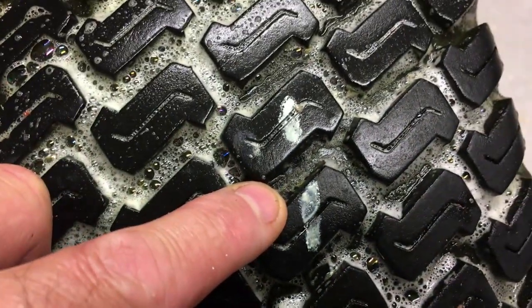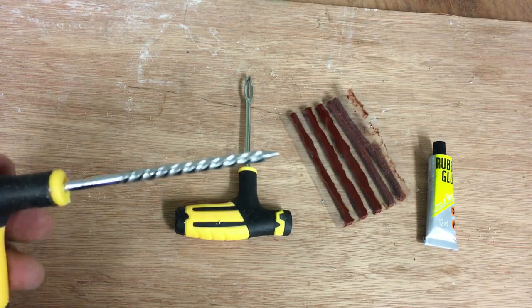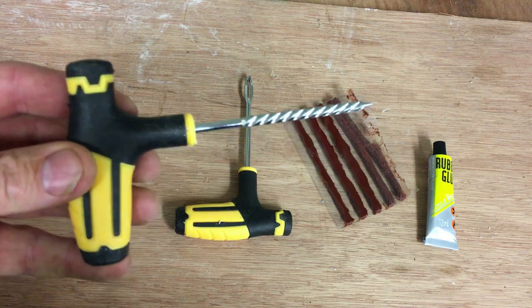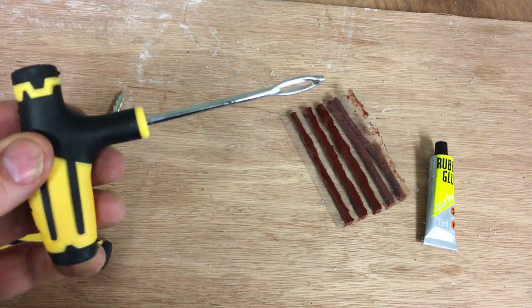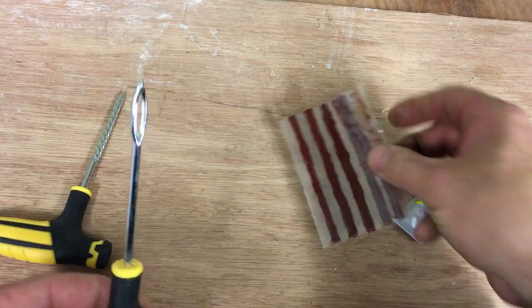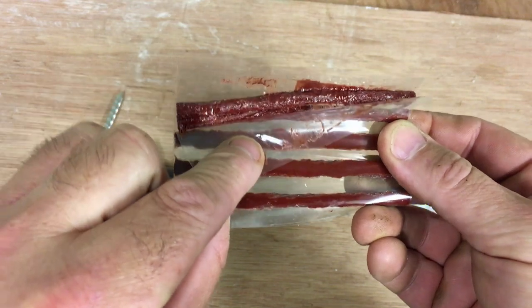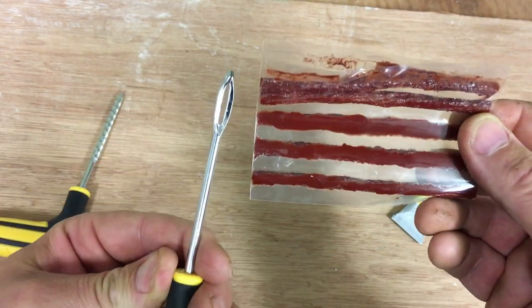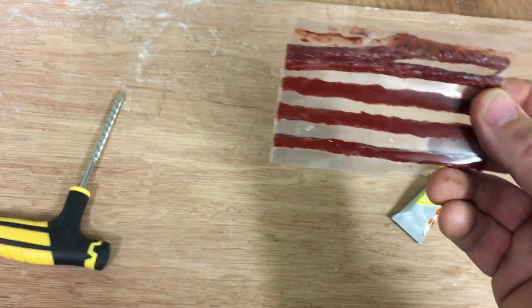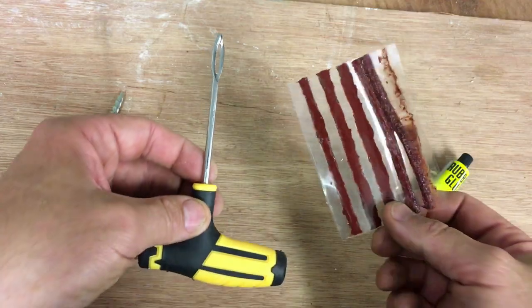I've marked it — I could see the hole, so I've just put a couple of white marks on it, and there's the hole at the tip of my finger. Here's the repair kit. We've basically got a drill-type tool which you pierce through the hole and rasp to clean the area. We've got a threading tool where you thread through the actual plugs — these are rubber strips with some sort of adhesive on them. You force the threading tool into the tire, pull it out, and it leaves the plug in the tire.